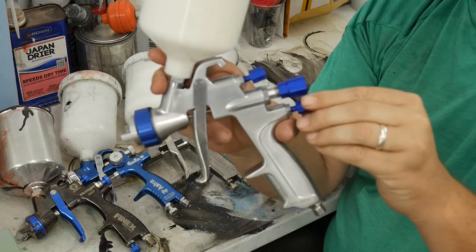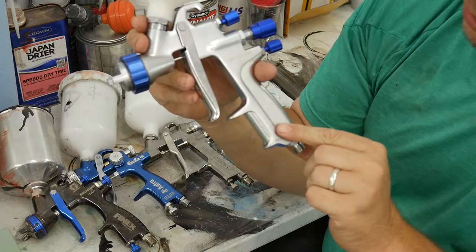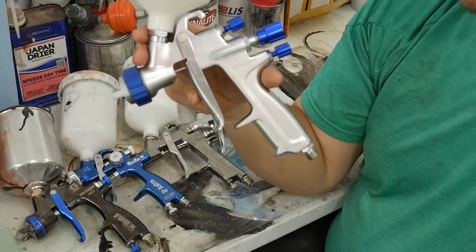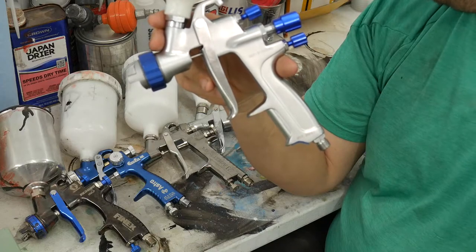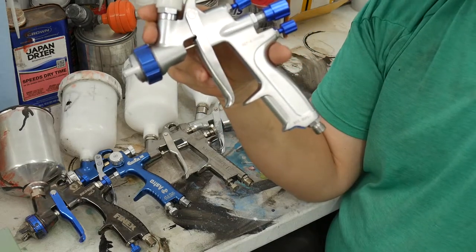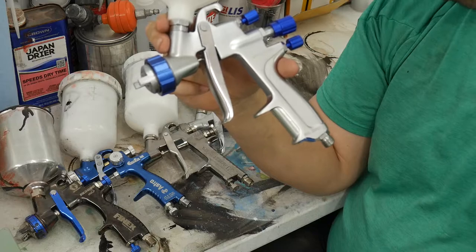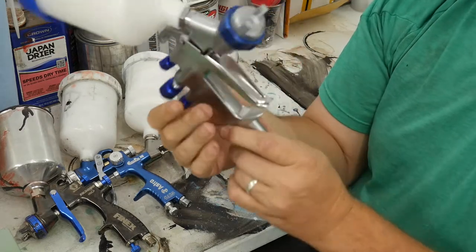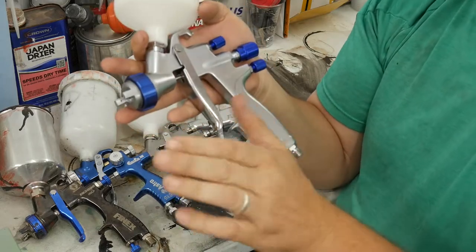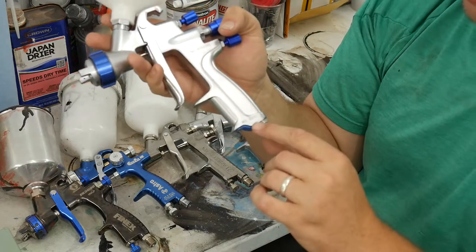Yes, you can paint a panel with it, but none of the other guns will give you the headaches this one will. It's a 1.4 tip. The good things: it's fair quality, looks neat in photos, but feels cheap in the hand and it's heavy. The spray quality doesn't compare to a real professional gun designed for automotive painting. It only has two air holes, doesn't put down a good fan, and to get a decent narrow pattern you have to crank up the air pressure — but it has a 35 PSI max.